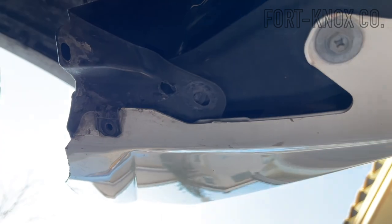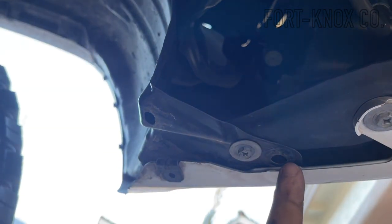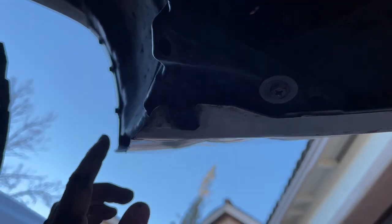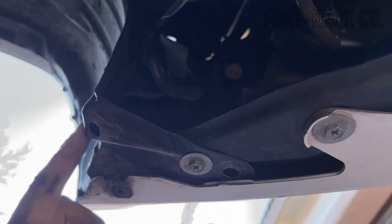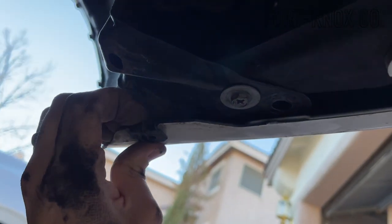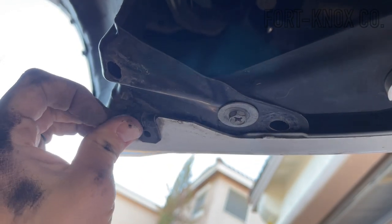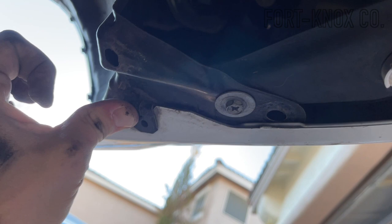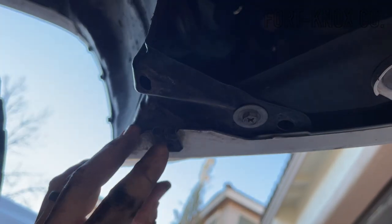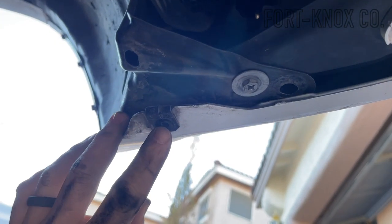That's back in place now. It actually pulls the plastic back almost a full two inches. Now there's a lot of clearance, and it matches the cut we made on the body. When you put back in the other screw, it actually has a pointed head on it, so when you push it up against the plastic and apply some pressure, it will pierce through the plastic. I was able to get it to reach through the plastic and into the threads, and it was secure on its own — so no drilling required for this one.